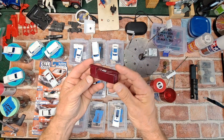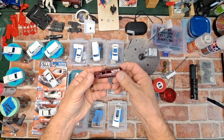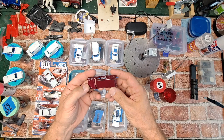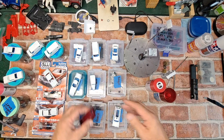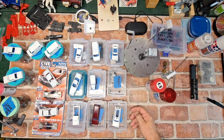This hearse was black when I got it. It's been requested to be maroon in color, so this is my base coat of maroon. It's been sitting for about 24 hours, so I'm going to wet sand it for the first time and get some of these blemishes out of there. We'll see what it looks like — maybe another coat, maybe not — and we'll be doing some airbrushing on some of these.